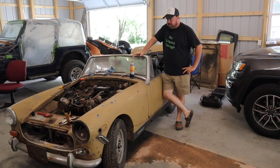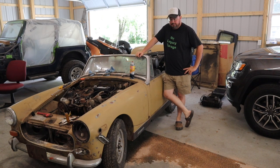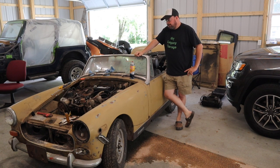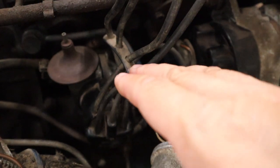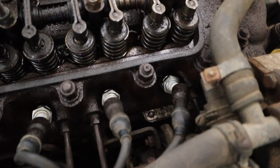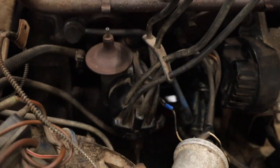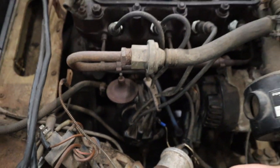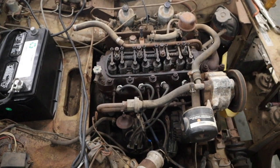I think we need a fuel system. It's been a little over a week since I messed with this thing — we went away, had a vacation. Now it's time to get back to work. I think we left off needing a fuel system set up. I'm also going to look at switching some plug wires around because that number one plug wire is a little short and I don't think we're making good contact there, which might be contributing to the hard start issue. The distributor is oriented so that the number one wire is a little short and not all the way on. I think I can take the cap off, unscrew the wire, and switch it with one of the longer ones.